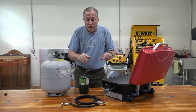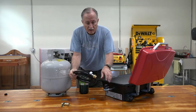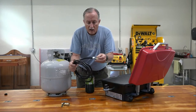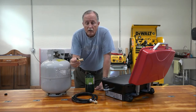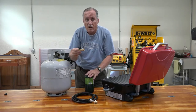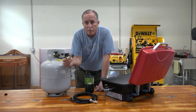This little gray thing you see here is a regulator, and that knocks the pressure down from 145 PSI down to a half a PSI, which is very light - that's what you cook with, only half a PSI. So you have to be careful when you're doing your plumbing to get it right. This hose I want to get is rated at 350 PSI, so that's really good. But this quick connect I bought is wrong - it looks right and everybody's using these, but it's only rated at 10 PSI. These are 145 PSI, so that's way too low. You have to buy a high pressure coupling.